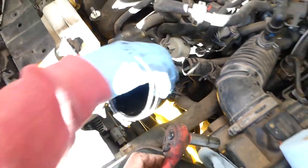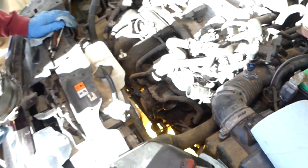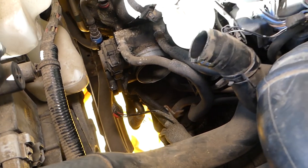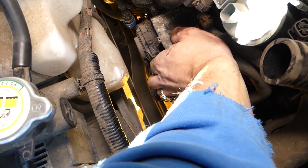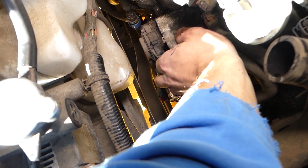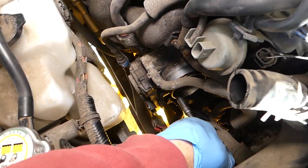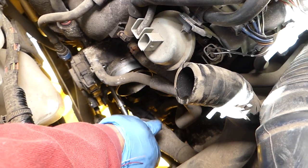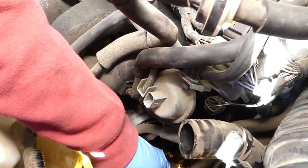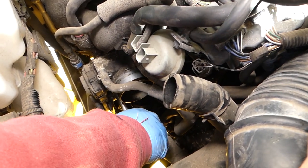Let's go ahead and pull the hose out. This is the hose clamp right here — you can see how much oil we have here. Using the 10 millimeter socket, we'll be able to remove all four bolts pretty easily — one we already got loose. This one just needs a little bit more. Once you remove the throttle body, you have to be super careful not to drop anything into the intake, because if you drop something it'll go into the valves and you'll ruin your engine.